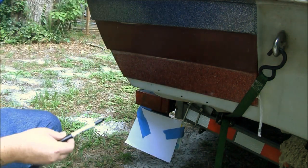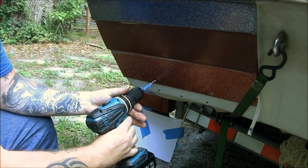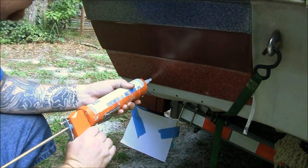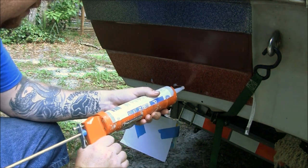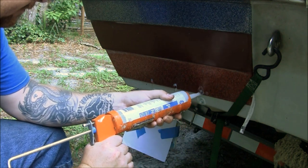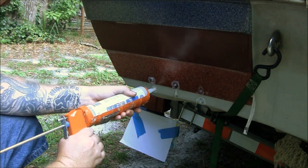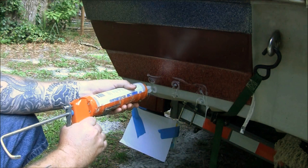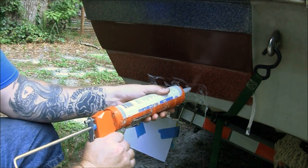What you want to do is take a drill to the 7/32nds and go ahead and drill out your holes, which I've already done. Now take some silicone, put some silicone in each one of your holes that you drilled out, and apply a little bit extra around to circle your hole as well. It doesn't have to look perfect — it's going to smear out flat. More silicone the better; any excess is going to squeeze out.